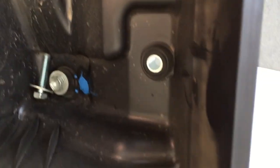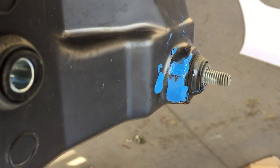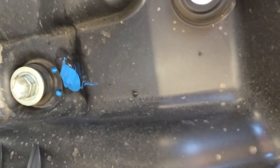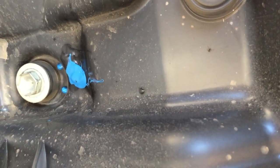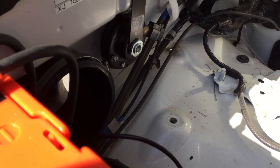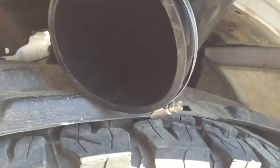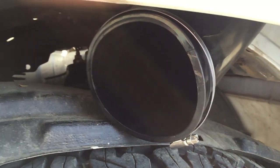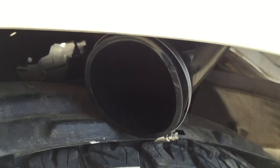Safari advised blocking the drain holes — there were three drainage holes in the bottom of the air box that can allow ingress. I've gooped a bit of blue sealant in there and that'll be alright. The next step was to fit the tube through the inner guard. It wasn't an easy fit — in fact it was a real pig. I ended up spraying just a little bit of silicone lube on the outer edge of it so that it would pass through that big channel up in there. That's all done now.